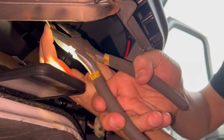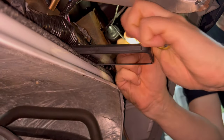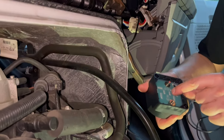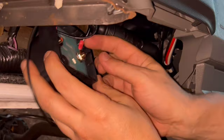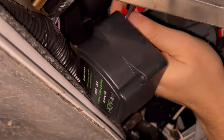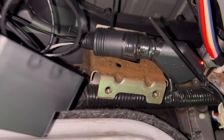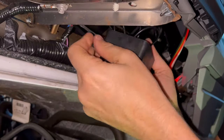Let's go! I cut the positive wire on the outlet adapter that powers the dash cam, strip both ends of the newly cut wire, crimp on connectors according to the battery isolator instructions, secure the connectors to the posts on the isolator, connect the isolator's ground wire to chassis or another ground wire, start the truck and make sure it's working right, secure it all with zip ties, and put the dash back together.